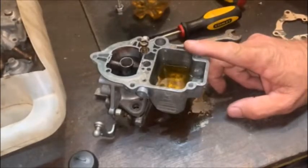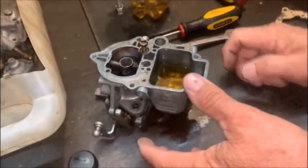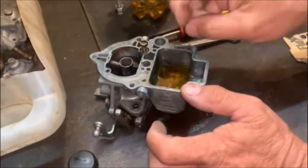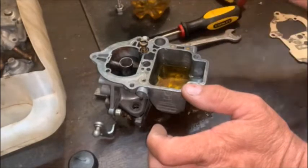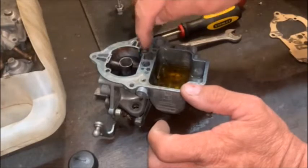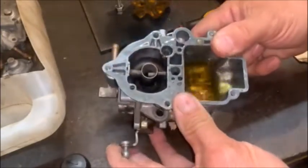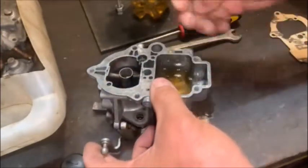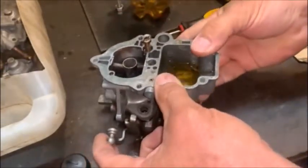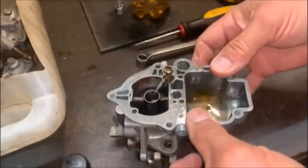I've put a bit of petrol in the float bowl. Remember this thing was so, so corroded and I didn't want to strip down the pump - I thought I'd have to pull the pins and clean up the little ball and everything. But then I unscrewed this, put a bit of fuel down there, did it twice, and it actually drew the fuel in. And that works - see? Accelerator pump 100 percent.